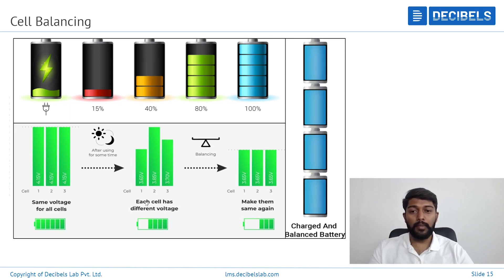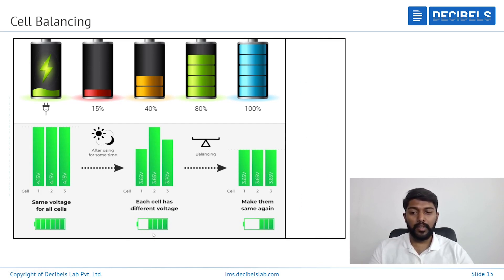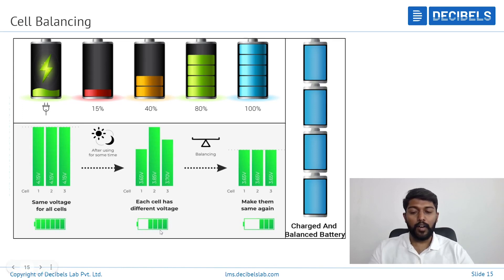What happens if cell balancing is not done? This is your remaining SoC — state of charge. Here you can see 4 bars of charge remaining. Even though there is an imbalance, the overall remaining SoC shown is higher — this is a pseudo value. If this battery pack is in your vehicle, based on this pseudo value you might plan a trip for more than 100 kilometers based on the range shown. But in reality, the overall capacity won't be to the extent what's being shown. If the pack is balanced, you get the right value and the right capacity available in the battery pack.